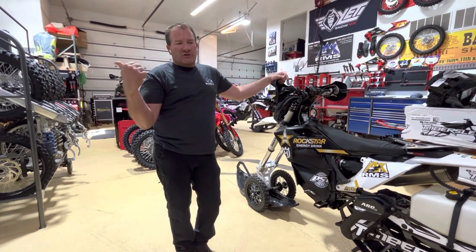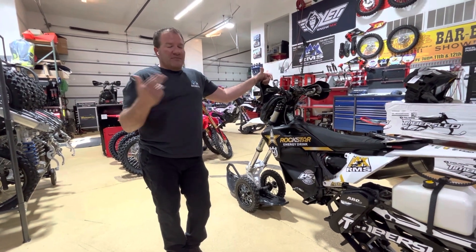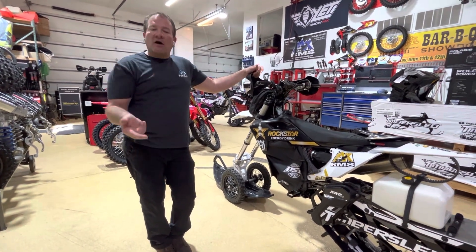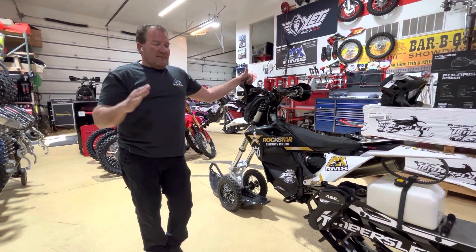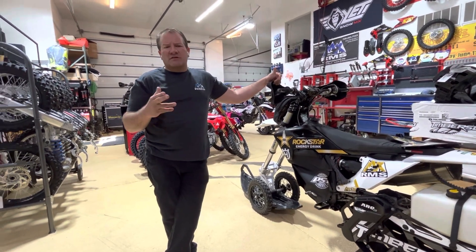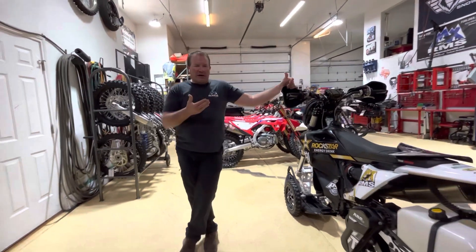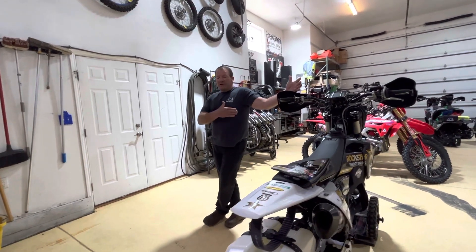We did run this same track on our two-stroke. We weren't really happy with this track on the two-stroke because it took a lot of the fun playfulness out of it — it made our 300 climb and hang with four-fifties all day long, but it wasn't 300 kind of power. That's why I say this big three-inch track works really well with 450 power, and also works really well with 501 or 500 power too. This is a great coupling with either one of those two bikes. If you've got some questions, please give us a call. This is our rundown of our 2023 KTM Husky builds. Also, when Gas Gas transitions to the new motor — I think Gas Gas is getting this new motor in 2024 — this would be your 2024 Gas Gas build too. Give us a call; we can help you out with all of these great items for your snow bike build and give you all the technical advice you could possibly need in helping you build up what you want to run for next year.